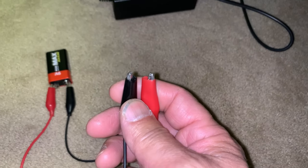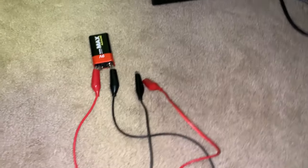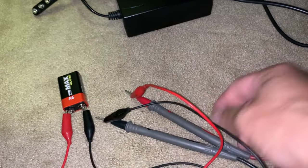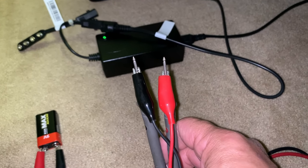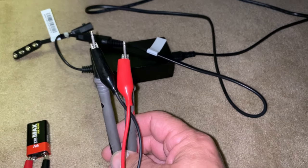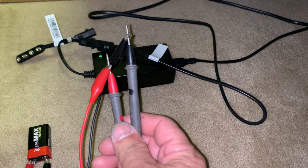Since it's a 9-volt battery, you're not going to shock or short anything out. Since I had my multimeter handy, I'm going to connect the two clips to the pin terminals and jam these into the connector of the motor to make it go up or down. With DC it's going to be directional — if it starts going up, just reverse the pins, stick them back in the connector, and it should come down.